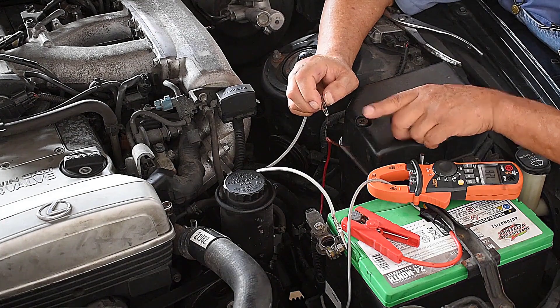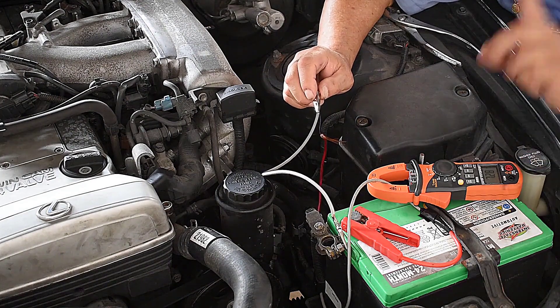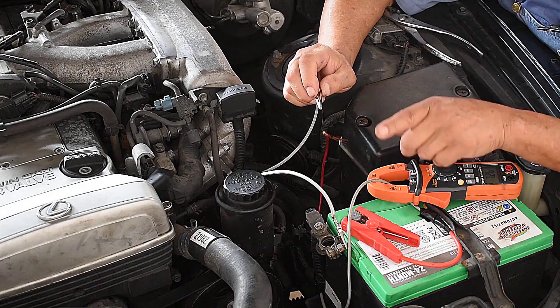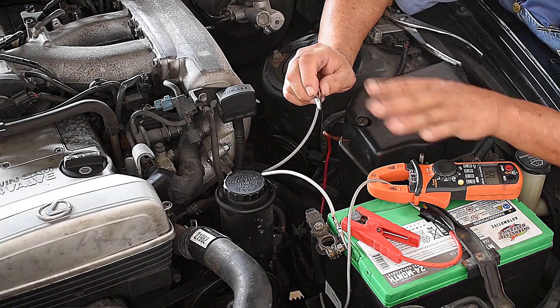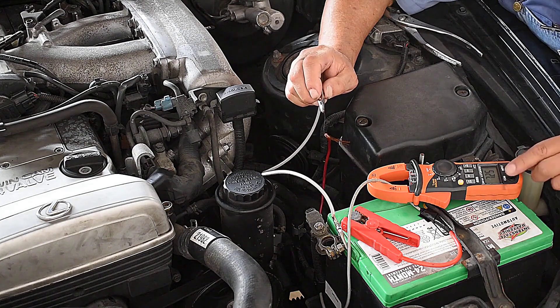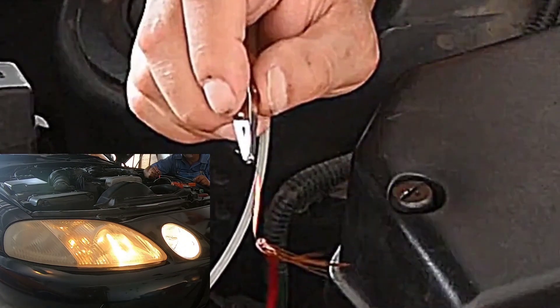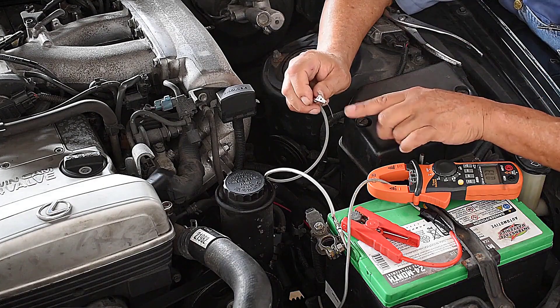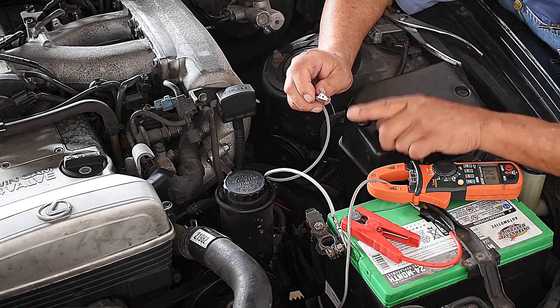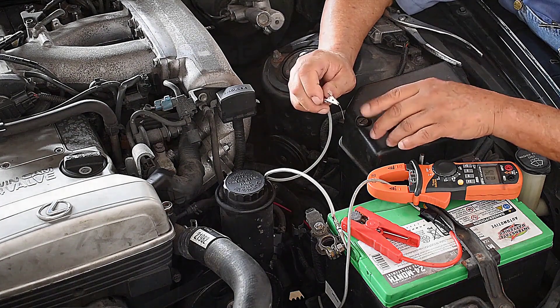Right now we have seven and a quarter amps. I'm going to let it burn — the limit on this pelito was about 17 amps. Can you give me some high beam please? I'm at 14 amps, and it looks like it did its job. The electrical protection did its job. That's what fuses do — they limit. If you go above 17, the fuse gets too hot because there are too many amps. The students had to set this up, start with a medium or big pelito, and work around, measure, see, and understand.